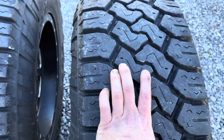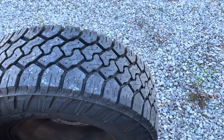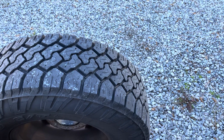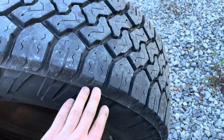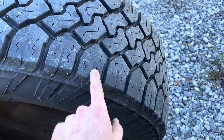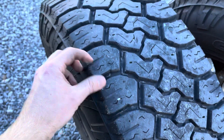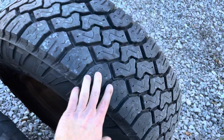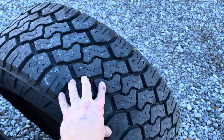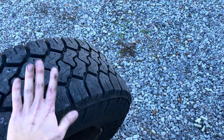This tire came off the front and this is going to be a good lesson. The last couple of rotations I have not been doing a very good job — this probably has a seven or eight thousand mile rotation and I was on a lot of bumpy roads during that time. See how it's almost flat there — not flat there, plenty of grip. This came off the front. Now check this one out — it looks pretty even. If I would have rotated these every four or five thousand miles it probably wouldn't be such a drastic thing.